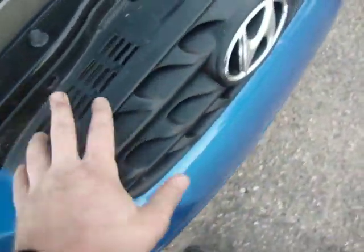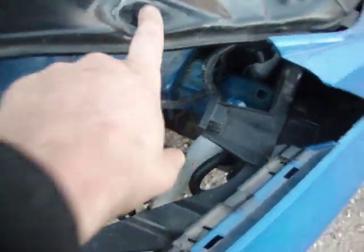I had to undo all of the bolts along here, undo this bolt, pull the headlight out, which you have to undo this and this, and you just stick your hand behind and give it a nice shove. Then you come along here and you undo that bolt that I earlier told you not to undo, and you just give it a nice firm tug along. Then, with your incredibly skinny arms and an extension on your ratchet, using a 10mm socket, undo the bolt that is located all the way down there, right there. And finally you get your washer bottle down.